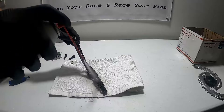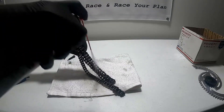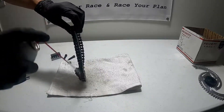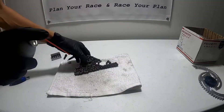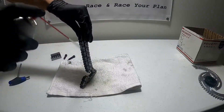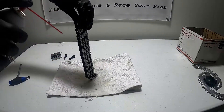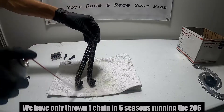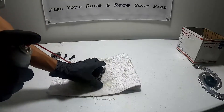You may not want to use brake cleaner if you have an o-ring chain — I'm not sure if they make 35 chains with o-rings, but we run a 35 chain. I'd highly recommend you also run a 35 chain. I've seen too many guys throwing 219 chains when they try to run them on 206 motors. I don't see any reason for it — there's a reason why they don't run 35 chains on two-cycle engines.